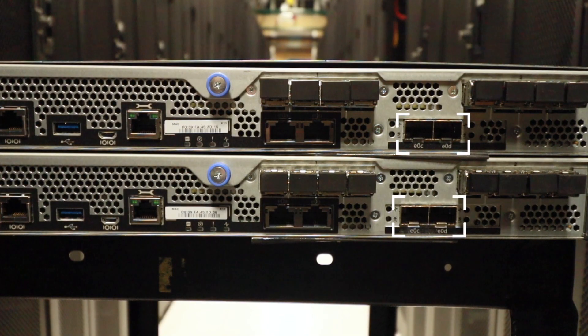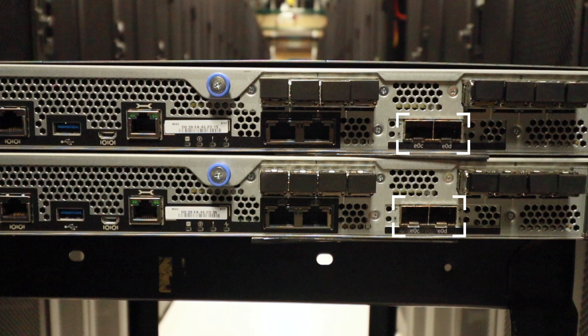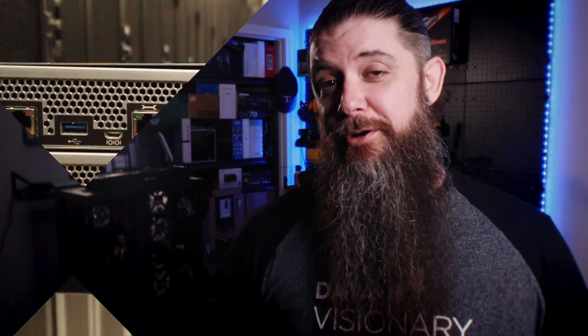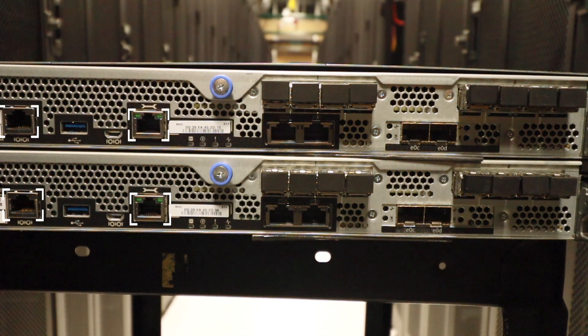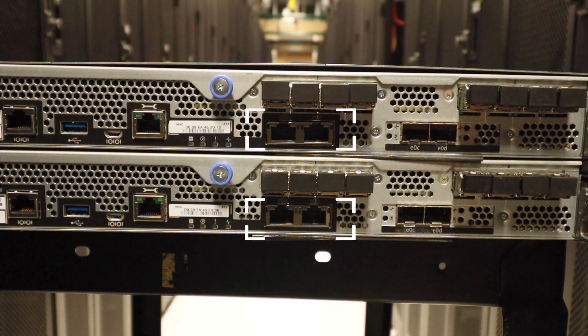So how does that compare to the newer A250? First up are the onboard 25 gigabit Ethernet ports — 25 gig on board. These are used for both cluster and HA communications. Because it is an RoCE v2 ASIC, the 25 gigabit Ethernet ports can utilize a better performing, more stable connection than the non-transparent bridging used in the A220. You've still got all of your onboard console and management ports for remote access and diagnostics, but there are also two 10 gigabit Ethernet ports on board for connectivity to either 10 gigabit or 1 gigabit switches.